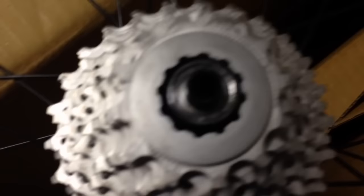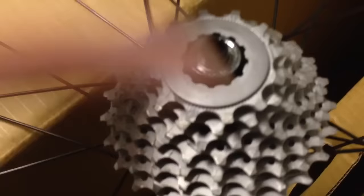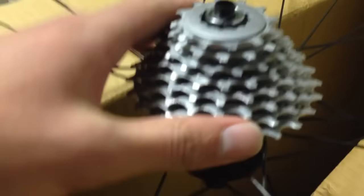As you can see here on my bike, this is the rear cassette. This right here is the special tool that inserts into this locking nut to loosen it. As you can see it's kind of like a hex design, but it's a special size and fitting that you need to remove this locking nut from the rest of the cassette. Then these first two gears come off and then the rest of the sprocket comes off. You also need a chain whip, which essentially holds the gears in place so the cassette does not move. As you loosen that special fitting you put a wrench on it and loosen it.